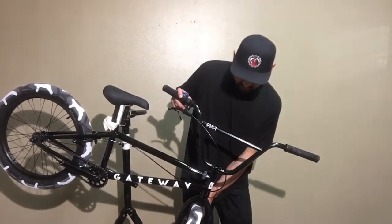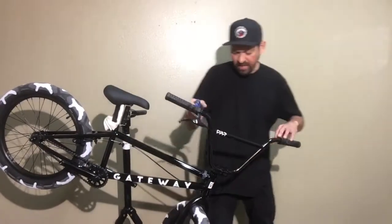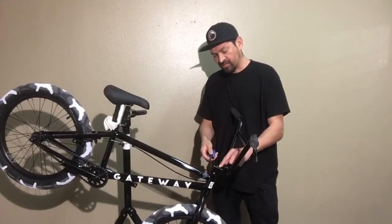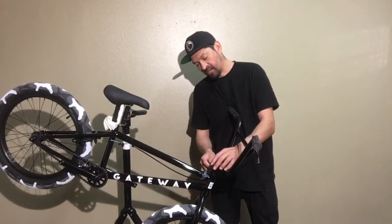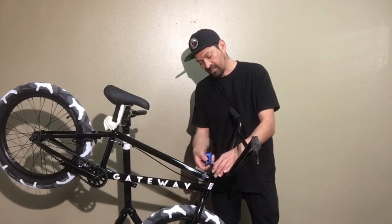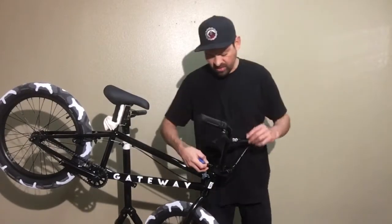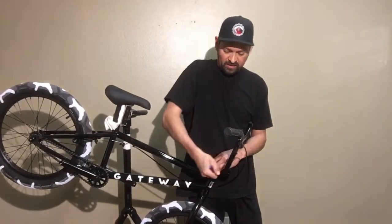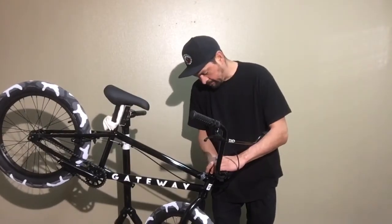So yeah, just straighten it with the wheel. Try not to wiggle it around too much. If you do and this headset comes loose, tighten this one up just a little bit. This one just sucks the bearings together, and then go ahead and tighten up the side bolts. But you shouldn't have to mess with that one too much, as long as you're not sitting there swinging the bars around, pretending your bar's spinning and stuff like that, and acting silly. But yeah, tighten those back up.